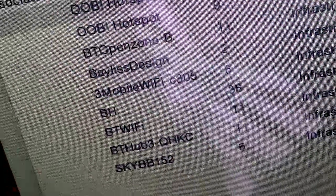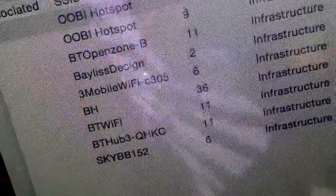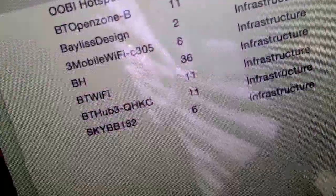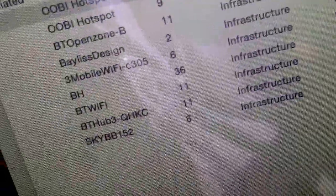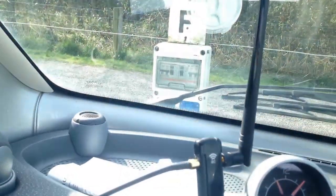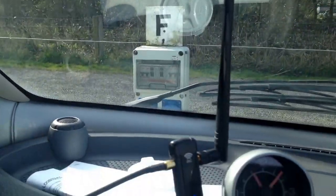Put that back on. Let's see if we can do a quick scan — available networks again. Come up, link status, just give that a couple of seconds to get back on. I'm going to back up and go another place and see what we get. What is interesting is that I do get a channel 36, which I think is 5 gigahertz. The closer I am, the more I've got a chance of negotiating that 5 gigahertz connection. But I'm not using a 5 gigahertz aerial — I'm using a 2.4, so I'm presuming it's using this aerial to negotiate that, or at least picking that up.